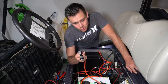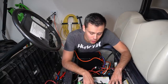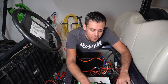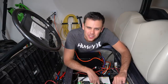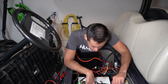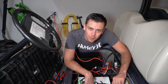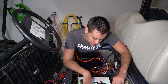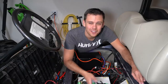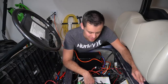We have an extension cord connected and we're going to try to charge it. It will charge, but we need to manually set the absorption voltage because we have a custom profile for this cell configuration — we're going to set it to 58.8 volts for absorption. The max absorption available is 58.4 volts, so that will have to do. It's charging right now, but the battery is already full so it's already hit float — so we need to go drive it a bit.